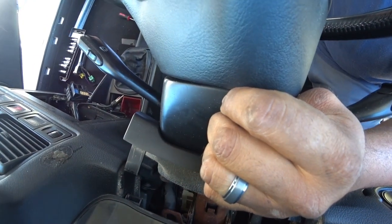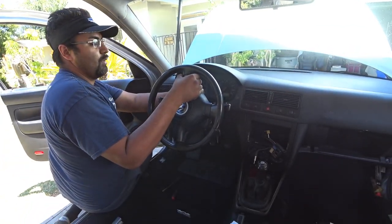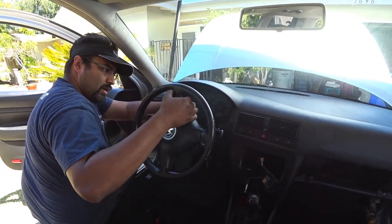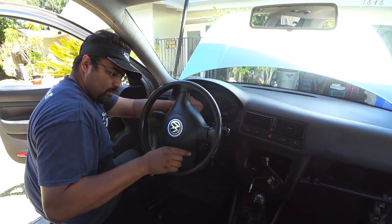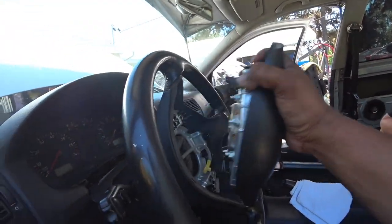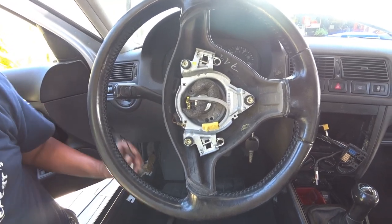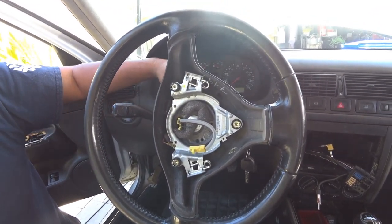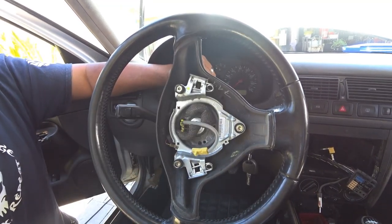Once you feel it, you can pull back on the bag. You should feel a little something in there. So now I got that little lever — I'm going to show you what it looks like on the inside. You'll see here, this is what you're trying to pry on right here. This little lever, and you got to get it right on the edge. Push it down and that's how you get the bag out. Same on the other side.